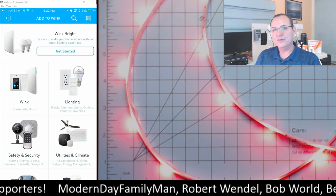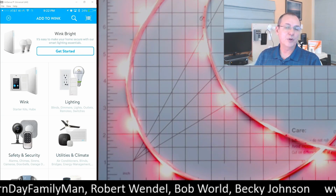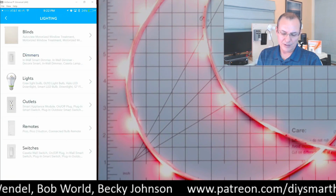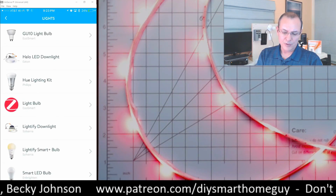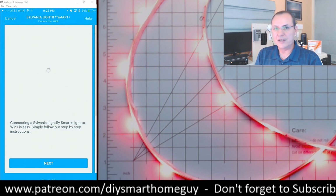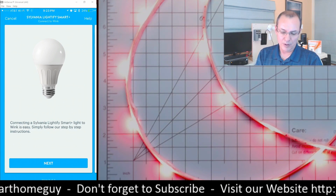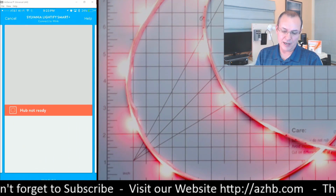Okay, so I've removed the Lightify strip from my OSRAM gateway, and now we're going to go ahead and put that into my Wink Hub. This is a little tricky, not too tricky, but it's a little tricky because when you go in here and look for setting this up, when you come under lights, you're going to see a section for OSRAM Smart Plus Bulb. Now what that means is these Lightify strips do not have their own setup utility inside the Wink Hub. You're just going to set this up like a normal Lightify bulb. Just do the normal. You're going to go in next, next, next, next, connect.